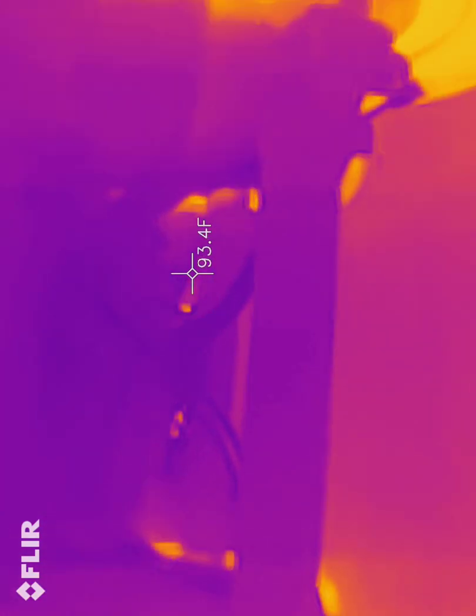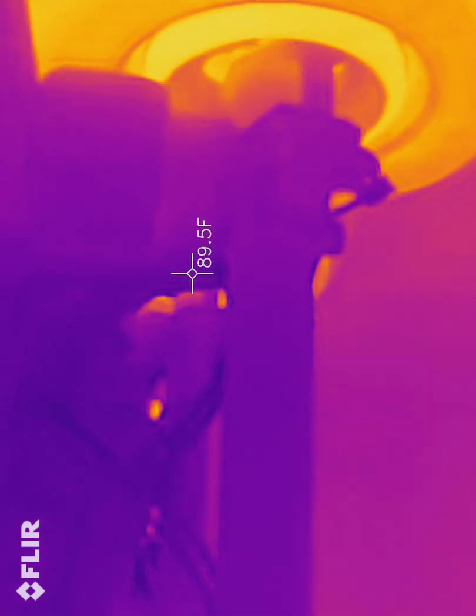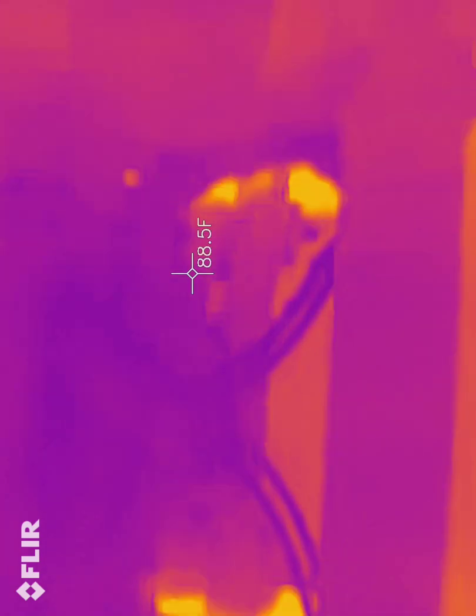The biggest thing with one of these is you'll notice everything looks cool right now except for the brakes. If you can't get the hottest part out of your frame, everything else is going to look cool. If I come here and get the hottest part out of my frame and let it recalibrate and lock that calibration in, you can get a little bit more of an indication of what's actually hot. You can see the springs here, just a little bit warmer than the airbag itself.